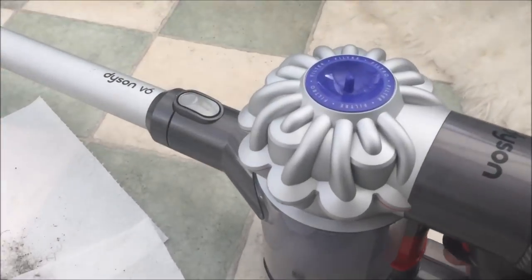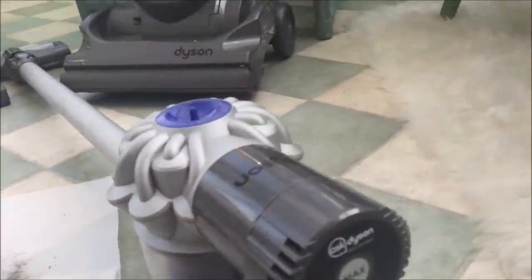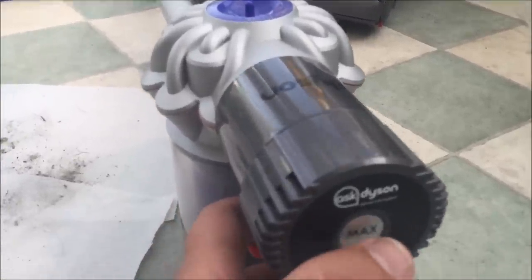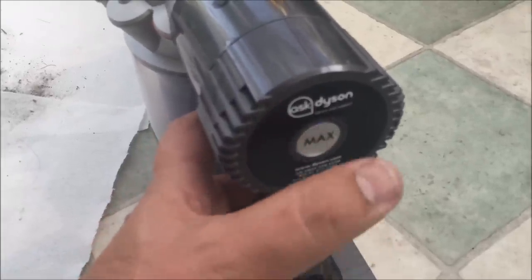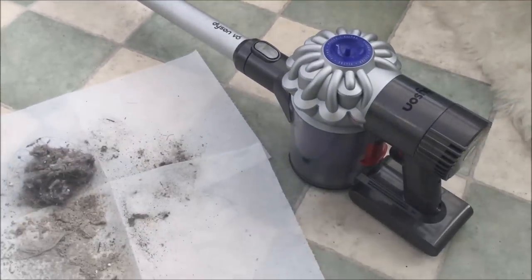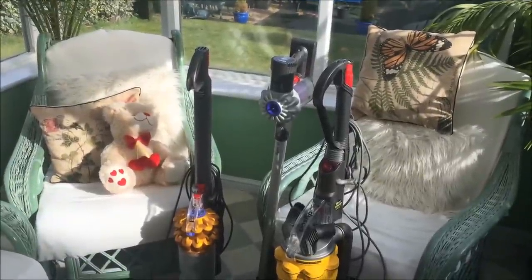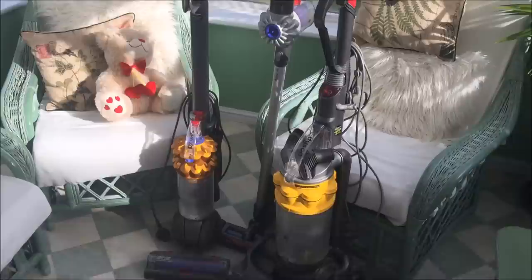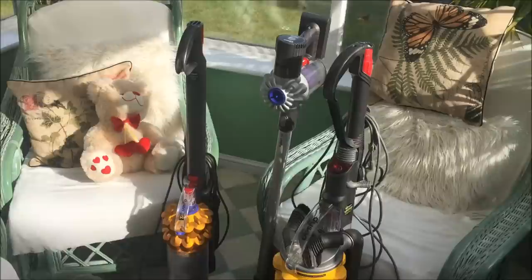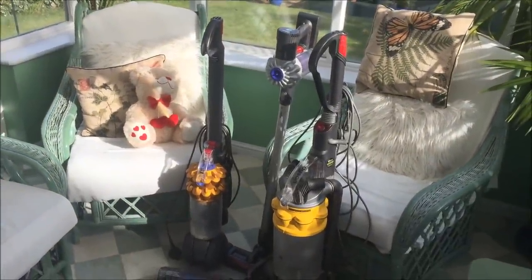So there you have it. That's all that came out of my machine — just with a one-cent or one-pence coin, a microfibre cloth, some kitchen roll, and scissors to snip those hairs away. We're back at full whack. Don't forget you've got your max button here to draw anything through that you've just been cleaning on the motorised head. Give it a quick blast and that will suck anything else left through the machine after you've been cutting. I do this about every quarter. I hope you found that useful on how to service your Dyson V6. Check out my other videos on how to service other Dyson machines, and I also have information on coffee machines. Please like, share and subscribe — bye for now!